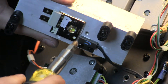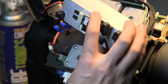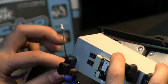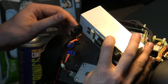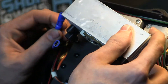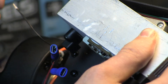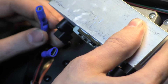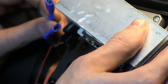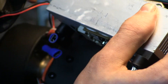Take your screwdriver and go ahead and tighten these screws back down — again, don't over-tighten them or you might risk stripping it out. Now you need to reattach your power cables. The red cable is your positive lead and the black cable is your negative. After doing this a couple of times, I found that this cable has a direction it likes — the curve should be curving down toward the heat sink.